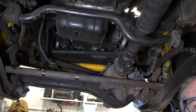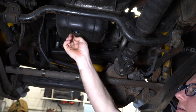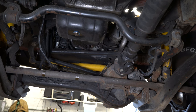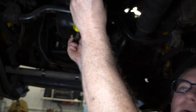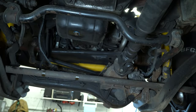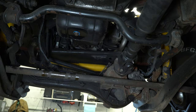We've finished draining. I've got a new Toyota drain plug gasket on my drain plug. Give that a quick wipe to make sure the steel surface doesn't have any dirt on it. Start that by finger, and then we're going to torque it to 18 foot-pounds. Then just rinse that off with some brake cleaner, so that if I go to check it later and there's any weep around it, I'll be able to tell if it's sealed or not.